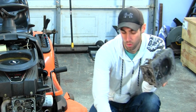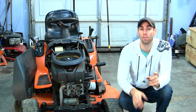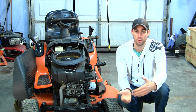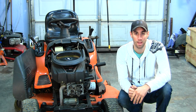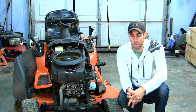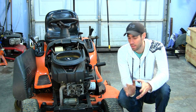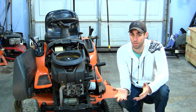What's happening with this mower is the customer says it uses oil — he notices it smoking when he mows on a hillside. To me that was the typical symptom of a blown head gasket. However, he called a small engine shop and they said he'd have to rebuild the engine and it wasn't worth it. So he called me for a second opinion, and I said I think you've got a blown head gasket — at least let me diagnose it. It could save you a lot of money.